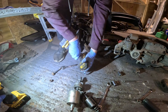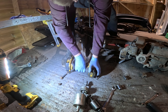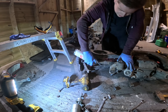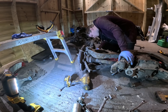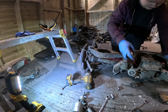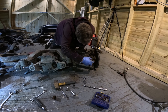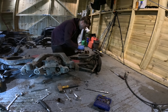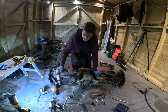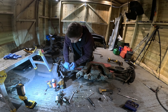These are 18mm from memory. Worth mentioning - these love to seize, especially the lower bolt which gets all the road grime. Be prepared to get your cutting disc out on this one as well. Let's try it with the gun. That's a good start - that was easy. Again there's nothing left of that bolt, it's very thin from rust - definitely needs replacement.